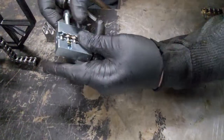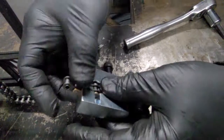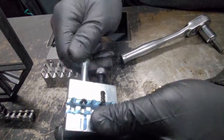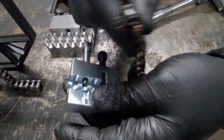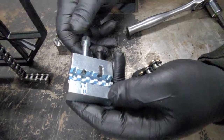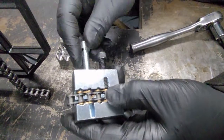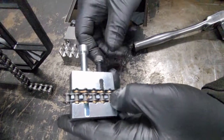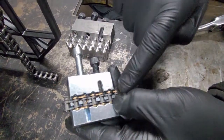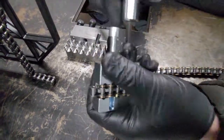So how this one works — when you get it, it's going to look just like that. You put your chain inside and it's going to lay in there like that. Like our previous video, it actually has a pin that drives through. This is nice because you don't need a master link. So if you're having problems with breaking master links and your chain's just not right, and you're buying one master link after another, you can use this breaker. So what you do is loosen this, make sure it's not in the way of the pin moving back and forth. Then you have to tighten this one down — this is very important, this is what keeps your chain safe and cozy inside the breaker. Tighten this down and go ahead and put a couple of ratchets on it.